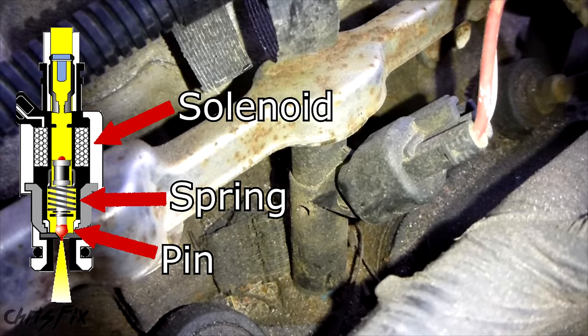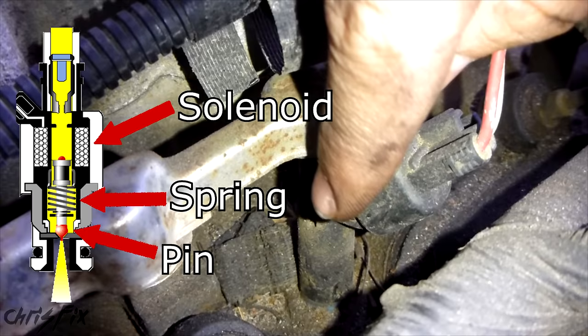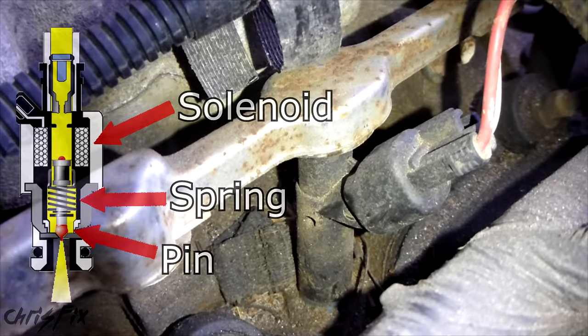What's actually happening is that inside the injector there's a coil that electricity goes through and creates a magnetic field, which lifts up a pin that is attached to a spring. The charge creates a magnetic field, lifts up the pin, and then lets go when there's no charge and the spring pushes it back down. So it's constantly going up and down, letting pulses of gasoline in — that's how the fuel injector works. That knocking or tapping you hear is the pin opening and closing.